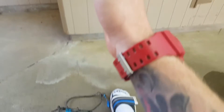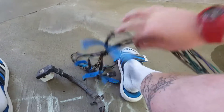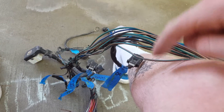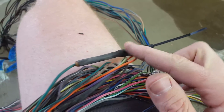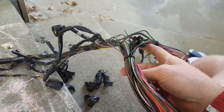Here are all my PCM connections, all labeled out, running up. This is the first shoot down the right-hand side of the motor — if I'm standing at the back of the motor, these are the injectors that run down that right-hand side. Each injector has a green with an orange tracer wire coming off of it. You can see them — there's one, there's one, there's one, there's one — and they're all coming up the harness into one single wire, which runs back down the other side.